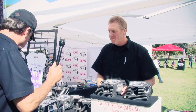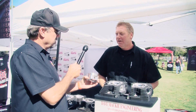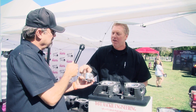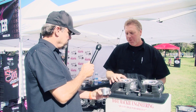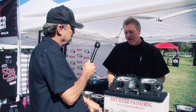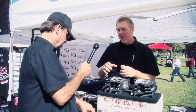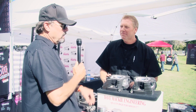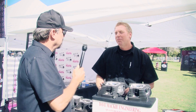So we have some other stuff here. Is this your design on the piston? This is Dave's design. JE does the forging for us because we think they're the best. It's that 360-degree near-spherical design, meaning it's almost comparable to a hemi. We complement the head to match the piston and it squishes everything, creates a wedge effect — puts all the downforce on the center of that rod. When you're pushing all this fuel into this motor, do you need some other system like a better fuel pump? More like a tuner, an engine management system. We don't make one, but there are companies out there that do.